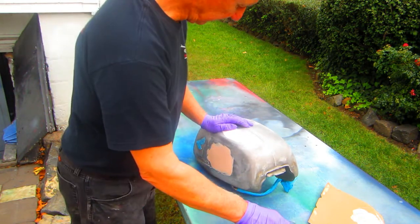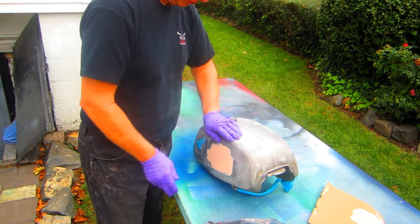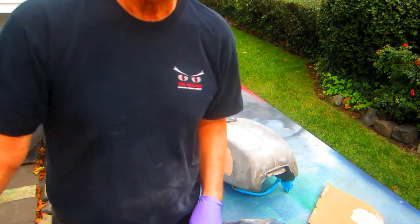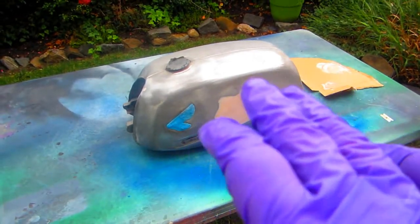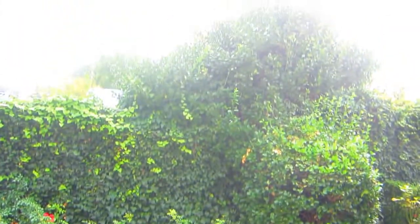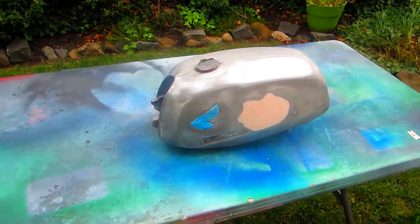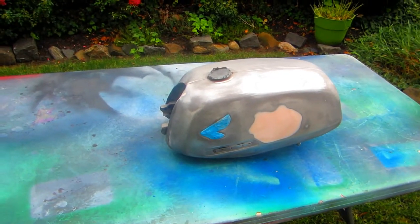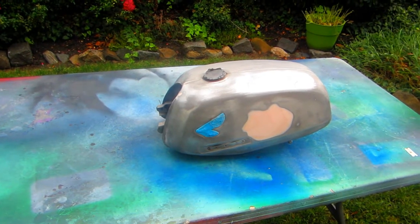The final little bit I'm going to do with a sanding block — a hard block — by hand, especially on this side which is going to need a lot of work. All the rough sanding is in. All the little final stuff I'll have to do once it's in primer. It looks like it's going to rain any minute now, so I decided to get this in primer, put everything to dry overnight, and count our successes.